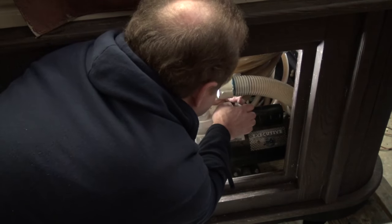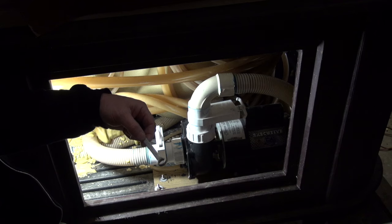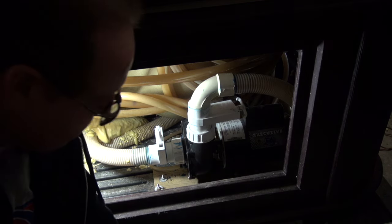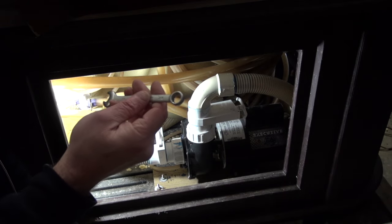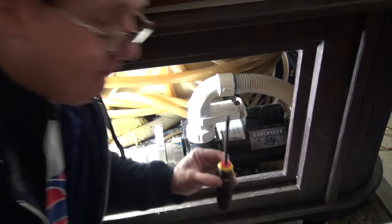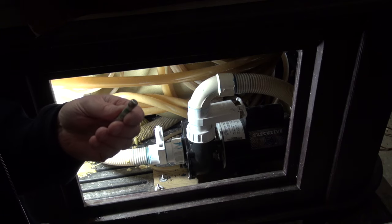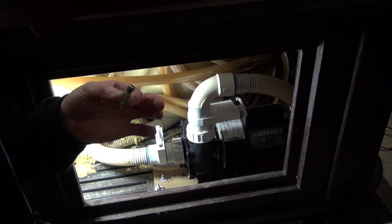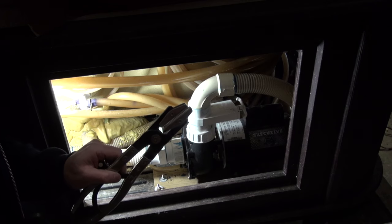If it doesn't hold, I'll have to take the water out of the tub. The next thing you would do is take the bolts out. In this particular case, this thing used a 7/16ths wrench. Because this pump is in the back, I don't want to pull the cable from the back to the front, so we're going to have to take the cable loose. You're going to need a quarter inch nut driver, oil filter pliers — in this case 7/16ths, but it can vary — a flat screwdriver to take the ground loose, and something to cut the bleeder hose and stop the water. In this case I use a bad 30 amp fuse, or you can use pinch pliers like you use on radiators in cars.